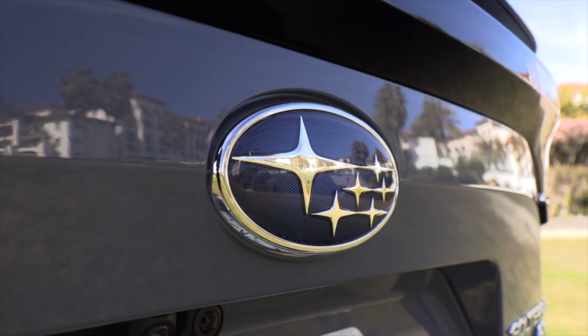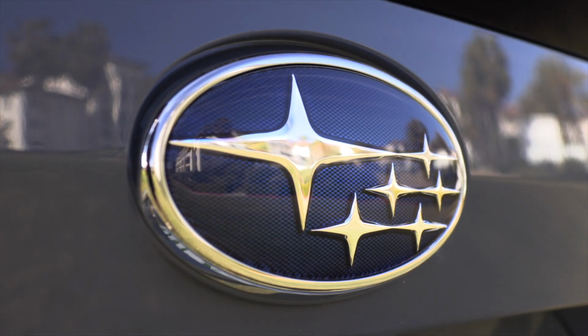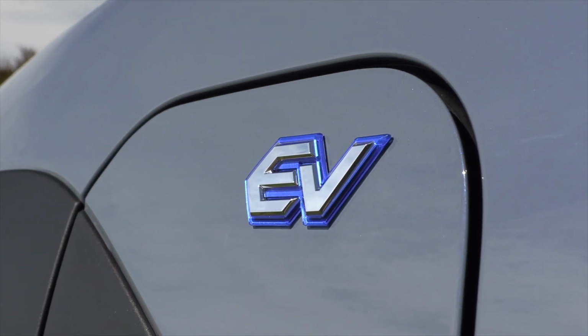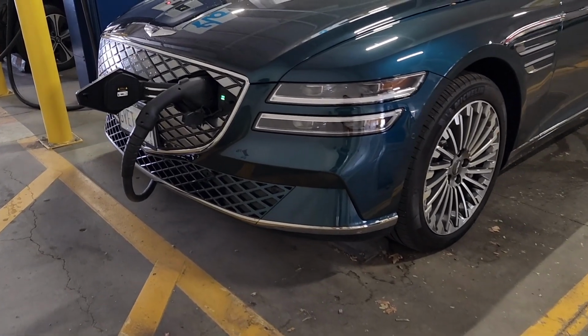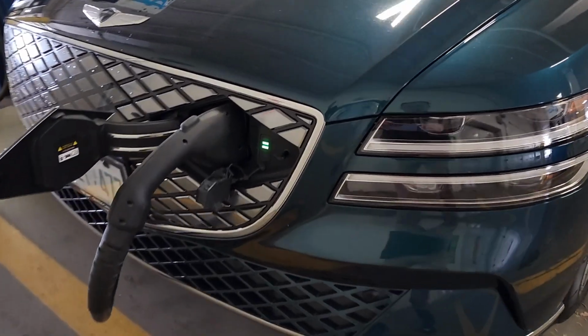Yeah, and Subaru's target is to retain 90% of the battery's capacity at the 10-year mark. Other manufacturers are coming in around 70-75% at the 8-year mark. One of the biggest problems is a DC fast charger, and every manufacturer will tell you to limit your time at them. Level 2 charging is better to save the battery.